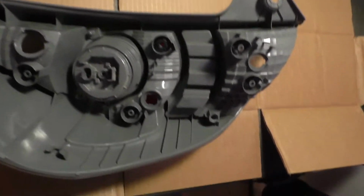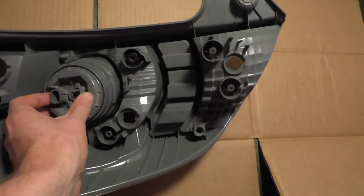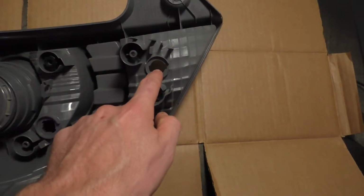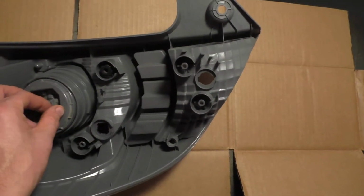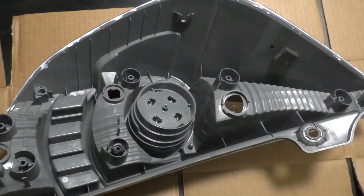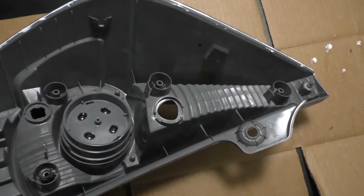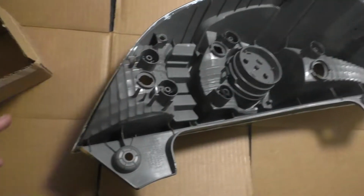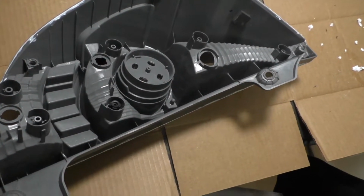And then I took all the stuff off the back of this, because the way that I clean it is I just spray a hose in all these holes and then just keep tipping it over and dumping it out. If your light's like mine and you can't tell where the leak is, when you spray the water in to clean it out, you just find where the water is falling out where it's not supposed to, and that'll show you where the leak is.